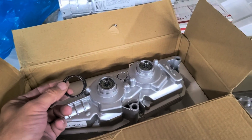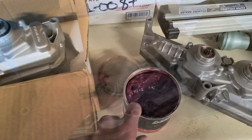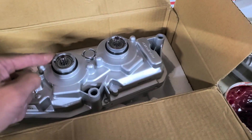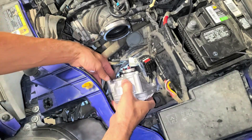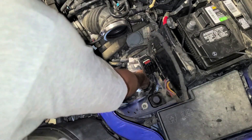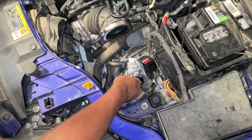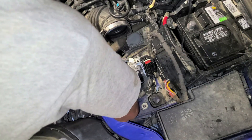Here's a look at the new TCM, which comes with new O-rings and has been pre-flashed with Ford Focus software. Before installing, I like to add just a small amount of grease to the gear and O-rings, which makes the install a little easier. Now it's time to place the new TCM in position — line it up with the holes, then begin wiggling and pushing it in place until it's flush. This may take a few attempts to get it to line up properly. Once it's in position, begin securing it with the four bolts, starting with hand-tightening in a criss-cross pattern, then torquing the bolts to about 10 foot-pounds in a criss-cross pattern as well.